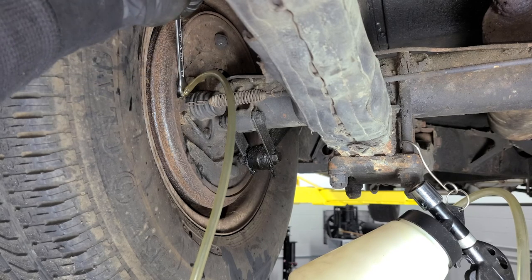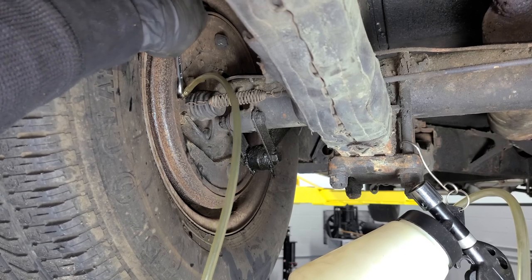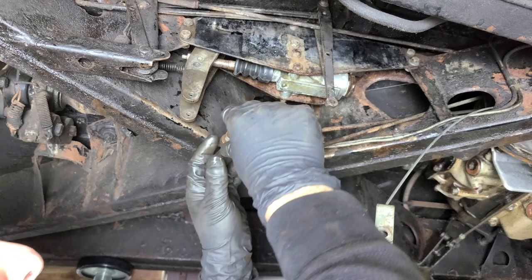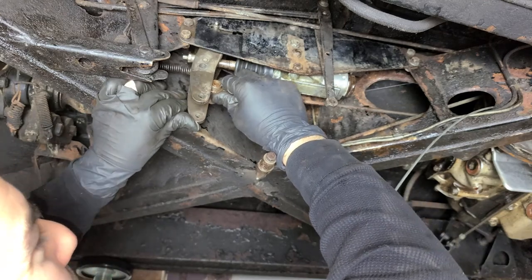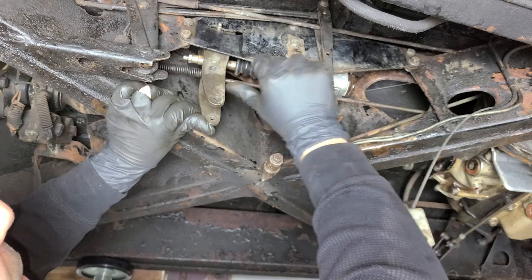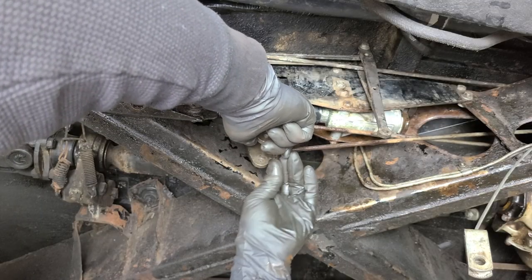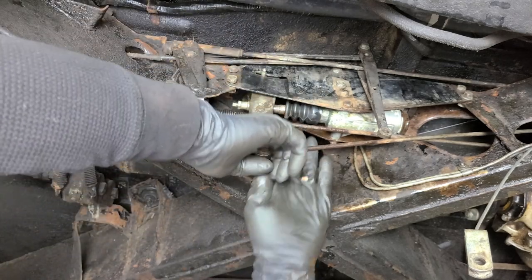This is a really good sealing hose — a lot of it is just dripping down the bottom of the hose, so you don't necessarily see it on camera, but fluid is definitely moving. One more — open. Nice. Closed, and we're good here. With the brakes bled out, we can reinstall our linkage. We're connecting our foot to the actual brakes now. And then we just have to do that again on the bottom. We'll tighten this up too — nuts on the back. We're almost done.